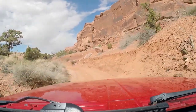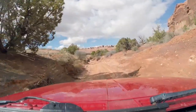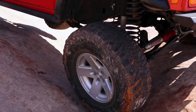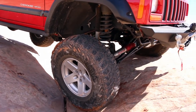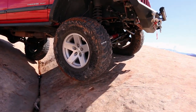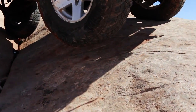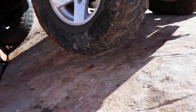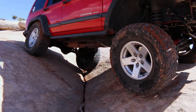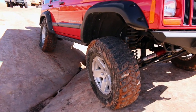As far as install issues, Mishimoto says this will fit stock, and it does — I had no problems at all. The only thing I had to use was their supplied brackets for the AC condenser. Other than that, it fit perfect. It does come with a 19-pound cap, which is not standard size for a Jeep. There are aftermarket caps you can pick up at an auto parts store, but my recommendation is to get a second cap and keep it in your vehicle — when a radiator cap goes and you're out in the middle of nowhere, it's nice to have one. As far as fluid, it took 1.9 gallons, which surprised me.